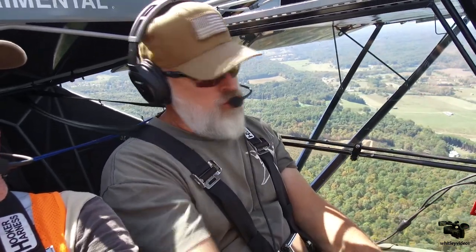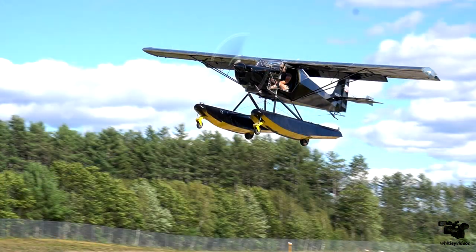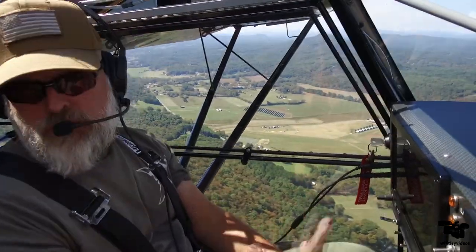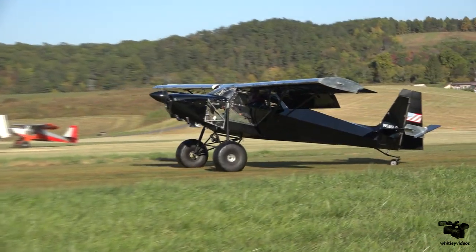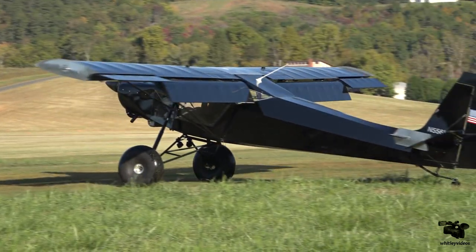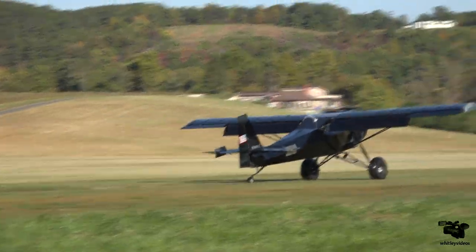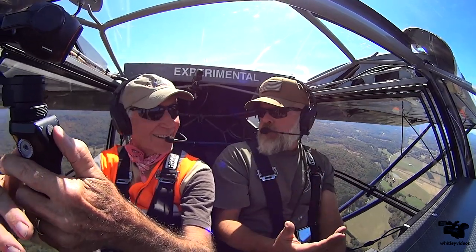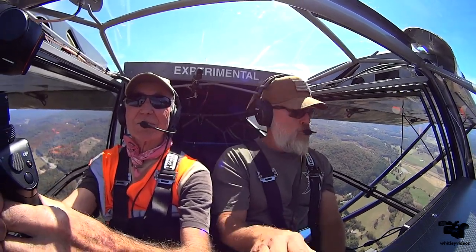What really comes into play is when I'm on floats. Oh, I can tell how that would be a really big help. Yeah, because now I can approach the dock, I can stop, I can back up, like a three-point turn. It also has what I'd call a feathering function. It's not really feathering in the sense of what a turbine does, but it's basically zero thrust. So I can start the engine at the dock, and I'm not producing any thrust at all. Which allows me to warm the engine up, and I haven't even untied yet. I'm just having nothing but fun with it.